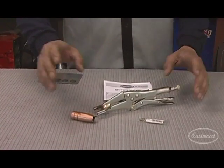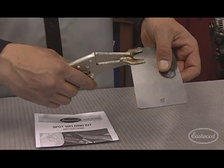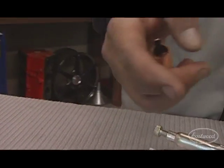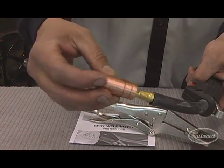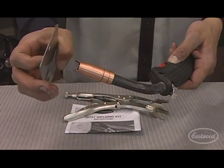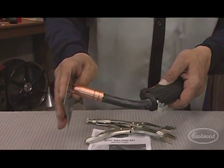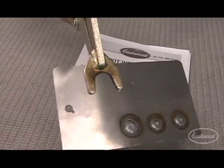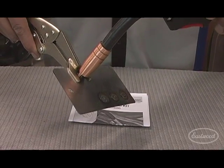The kit itself is very easy. We have these specially designed clamping pliers with cutouts — for any type of pinch welds, it allows you to clamp and secure the pieces together. Then this nozzle with leg extensions machined into it — this is a current MIG nozzle. What you do is simply remove that and install the MIG spot weld nozzle. These legs give you the exact standoff needed from the tip to the substrate every time. This is what achieves the repeatability and duplication of all the spot welds looking the same. The second feature is alignment — once your panel is clamped, the legs position right into the clamping area so you know exactly where the spot weld is going to be each time.